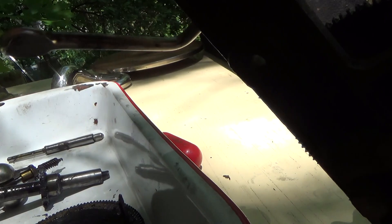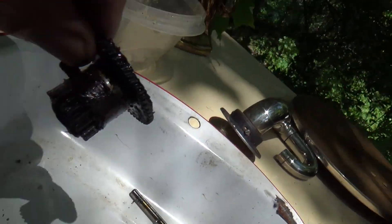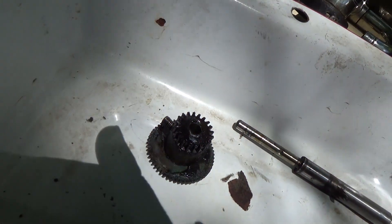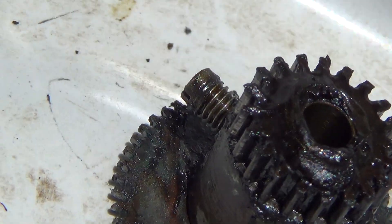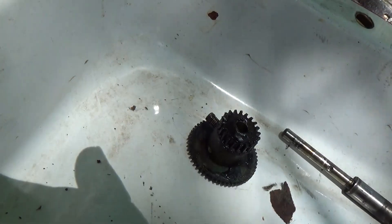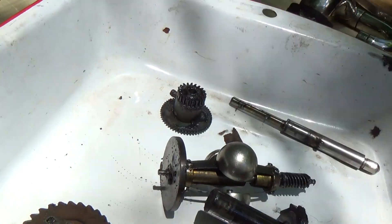In here goes this gear. I left the set screw in this one so you can see it. See the set screw there? That set screw was loose. This gear was loose, and eventually it would have fallen apart, and you would have been able to lift the turntable with the shaft completely off of the machine. Not good.